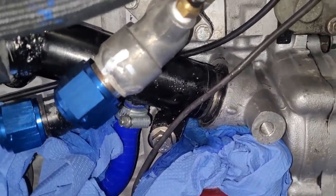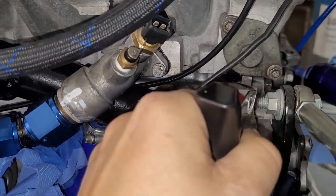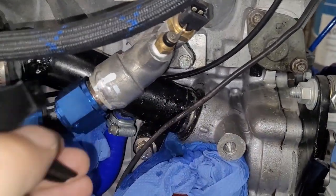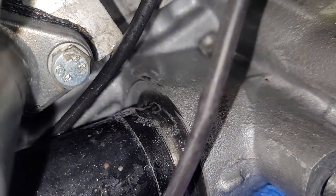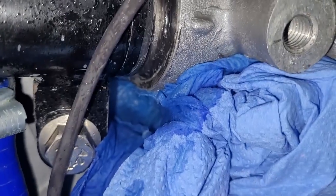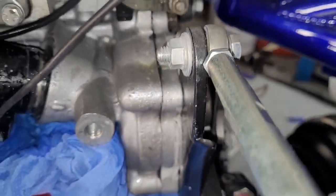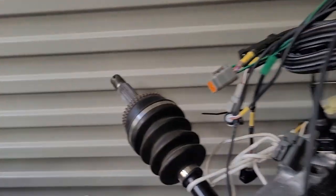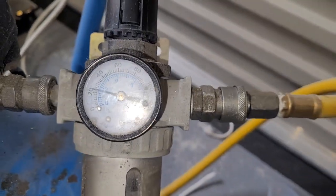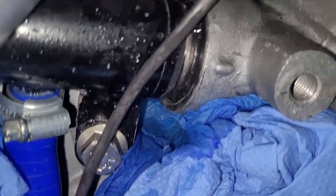We pressure test, I think we're all good. And the water pump. That's about a bar and a half of air. There's no bubbles. Water pump that thing and try again. I think it's about a bar. About a bar. 3/4, okay. Now we're going to go near that. I think we're all good there.